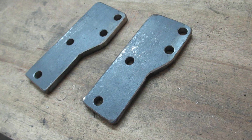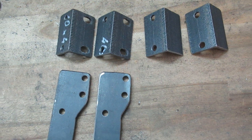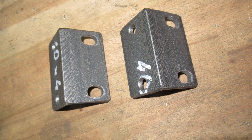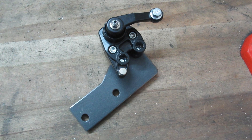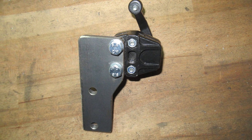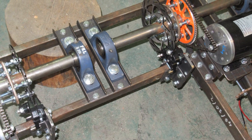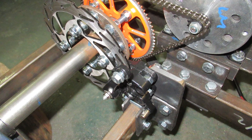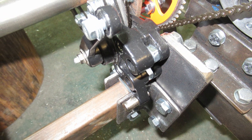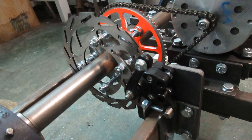The manufactured brake caliper brackets were provided with holes matching the diameter of the calipers, and the L-profiles had four of these holes ground into an oval shape. When mounting the brake caliper onto the go-kart frame, L-profiles were used, which grip the main frame profile using an M8 bolt. This allows the brake caliper to be shifted relative to the disc both laterally and longitudinally. The brakes are mechanical and will be operated using steel cables.